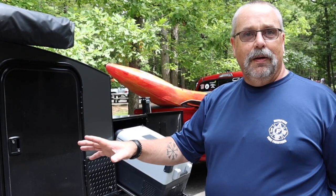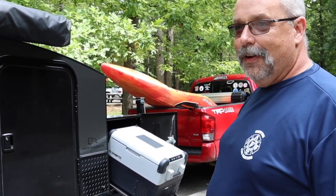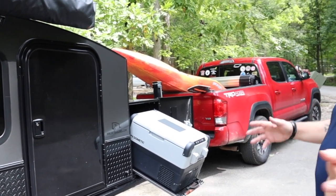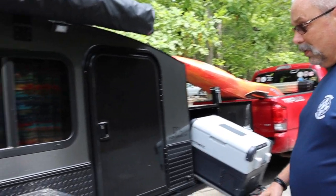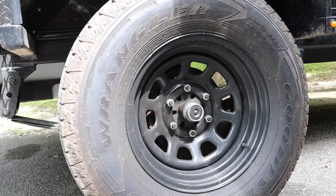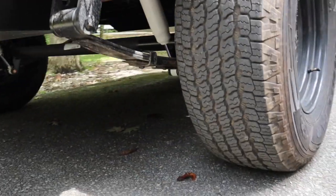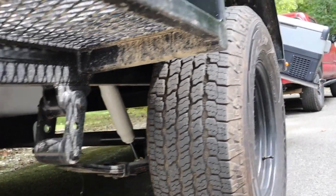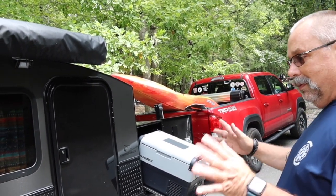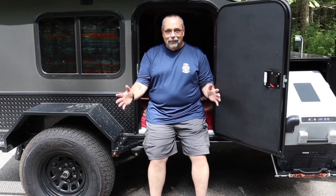I did not want to have to carry an extra spare tire just for the trailer. So I talked to Wes and said, look, I want the same size tires and the same lug pattern as the tow vehicle so I can just interchange tires as necessary. These are 31-inch diameter Goodyear Wrangler All-Terrains. When he put them on initially, there was a lot of space between the fender and the tire — they looked too small for the fender. So what he did is he took an inch off of the shackles on the leaf springs and dropped the whole trailer down. I lost two inches of clearance on the bottom of the trailer, but the trailer still has more clearance than my truck. Look — I can step up and my feet touch the ground. It's a little bit lower, and Wes commented that it's so much easier to get in and out of this thing with it just a little bit lower.